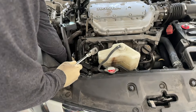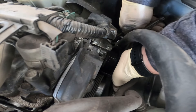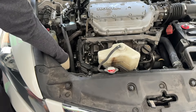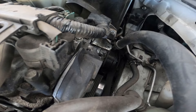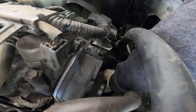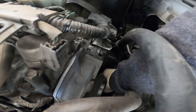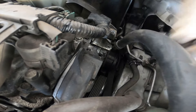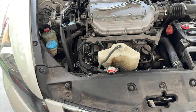It's really tight down in here. This bolt will actually slide through the AC compressor and the alternator. It has a dowel that keeps it tight. We're going to take this bolt out by hand the rest of the way. There's the bottom one — put that to the side. Now we'll get these top ones with the bracket, which are 12-millimeters.